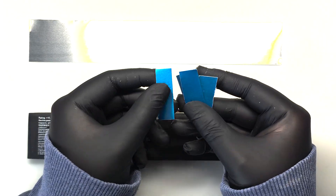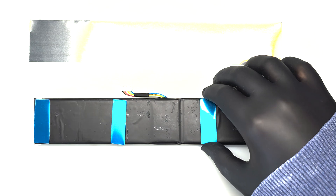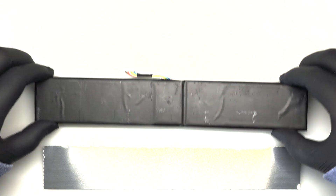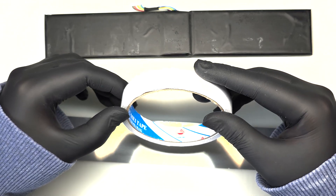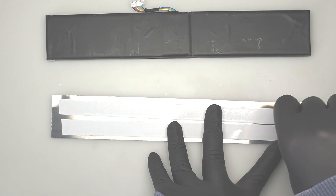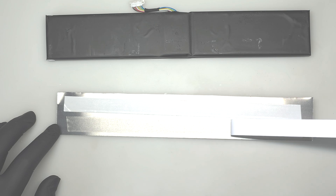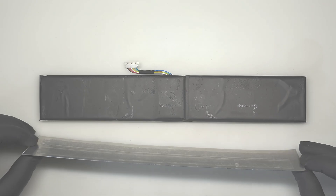To create the optional air gap, you can cut four strips of plate that are 40mm long and the width of your tape. You want them to be evenly spaced out over the battery, and when you put the double-sided tape on either side of the strips you can stick the plate to them and then to the battery. For the easier method, we just need to add double-sided tape to the plate and stick it to the battery on the side with no text. The tape I'm using is just regular double-sided tape — make sure it's the thin kind as we really don't have much space to play with inside the Ally. Make sure you can see a little of the battery around each edge of the plate before you press it down.